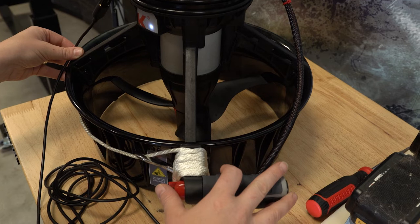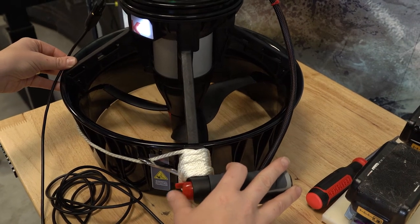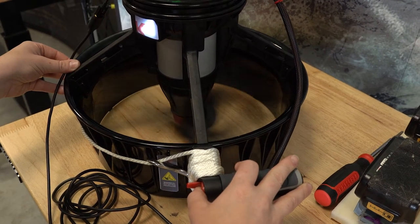Make sure to double check your work by activating the scooter after submitting the change. You may need to turn the scooter on more than once before seeing the new changes take effect. In this next example, I'll show you how to disable the Speed Migrate function that slowly returns your Blacktip's speed to Gear 3 after sitting idle for a while.